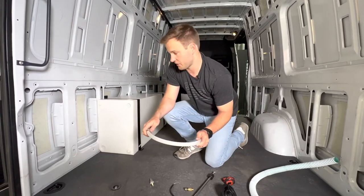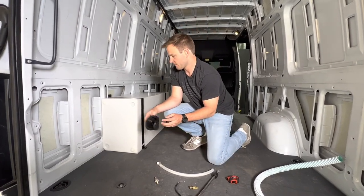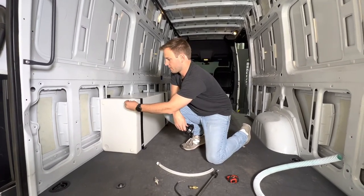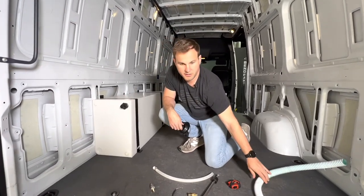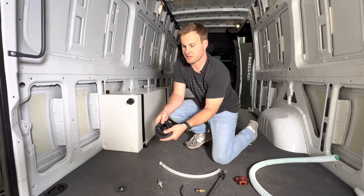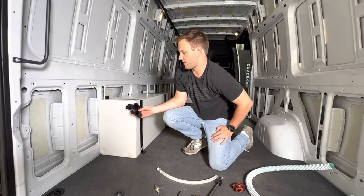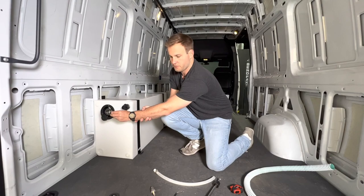While we're not including all these fittings and hoses, a couple of options for filling the tank: this is an inch-and-a-half — you can run an inch-and-a-half to inch-and-a-quarter fitting here. We like this RV fill hose that just gets pushed right on; it can connect to the back side of this gravity fill port. There's also a half-inch vent fitting that can be run right here — you can run them both at 90 degrees and fill on this side.